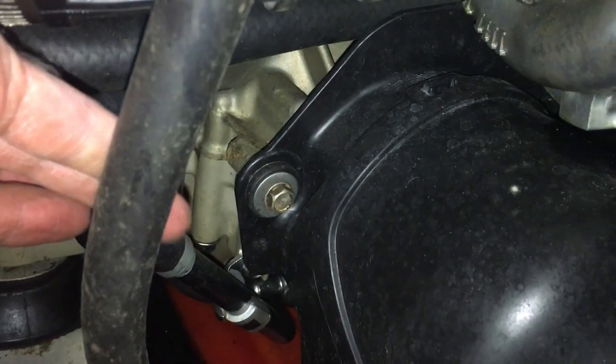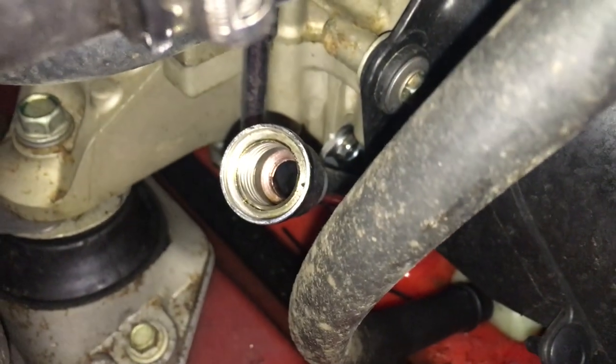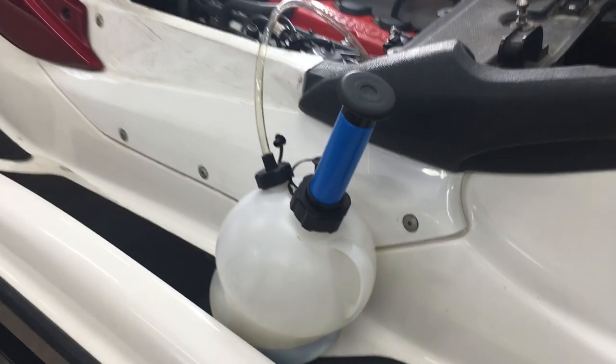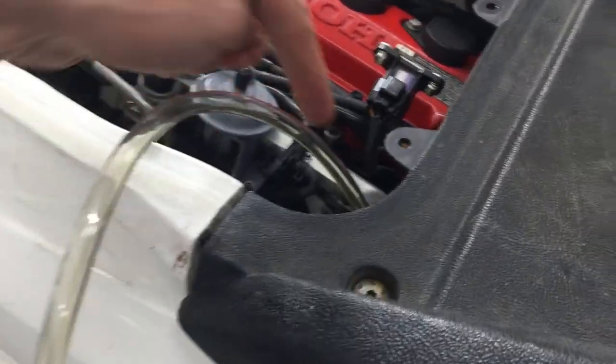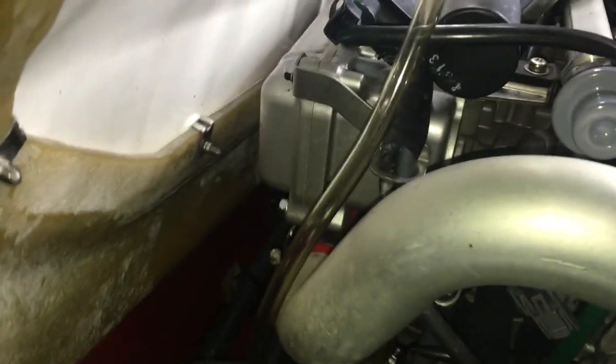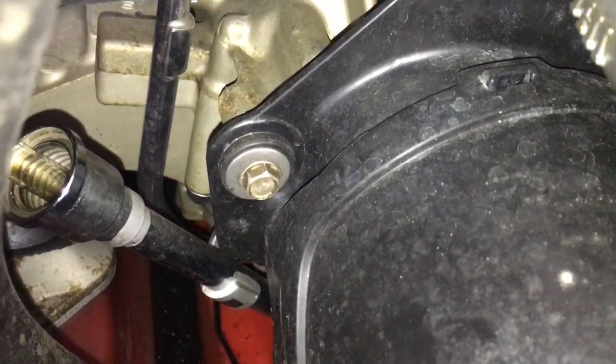I'm back in the hole here. Loosen the cap, and there's the oil opening for the pump tube. I'll wipe this down and set it right here. Here's where I'll set the pump. I find it's easiest to run the tube through the front seat opening, then down around the outside of the charge piping, behind the rubber intake tube, and into the hole. On a naturally aspirated model, you'll have less stuff in the way.